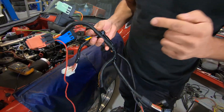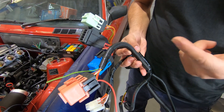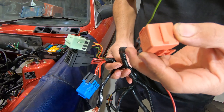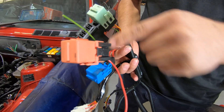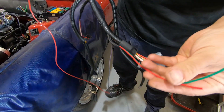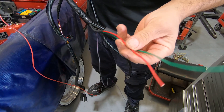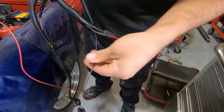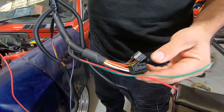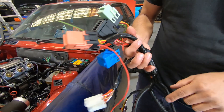Now there is a little bit of forward thinking in this section. For example, we need to add a fuel pump relay. Instead of adding a separate relay, we just took the old SMG relay and turned that into our fuel pump relay, and we modified the wiring to suit. We've also got positive and negative here — ignition and battery power for our OBD plug. And we've run our trigger for the fuel pump relay, added it onto here because this goes to the ECU. The fuel pump trigger is on a different plug but we run it through here to keep everything neat flowing through the harness.